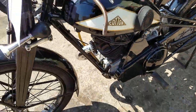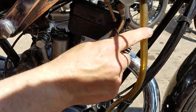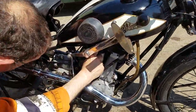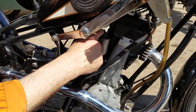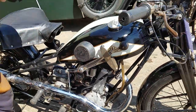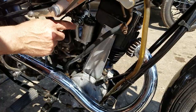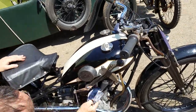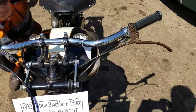Pull that out. The oil tap is just under here, down for on. You've got a clear pipe here, you can see the return. Little baby carburettor, laid on its side — that was a typical mid-30s trick, wasn't it? So we'll give it a tickle. The ignition is set. The mag has got no advance/retard on there, so it's on full advance, basically.